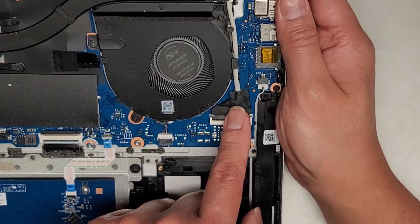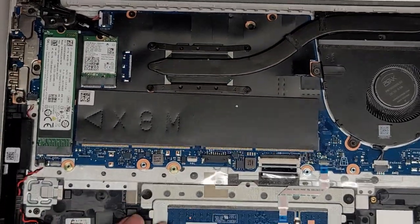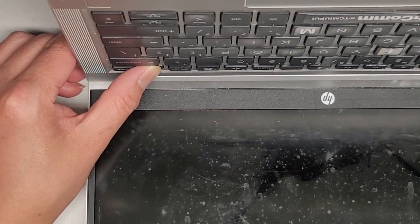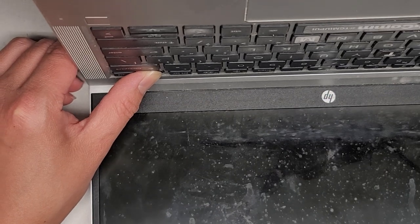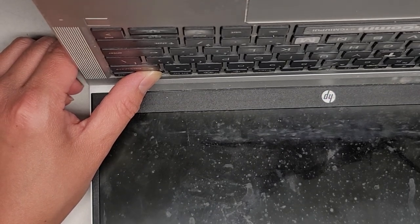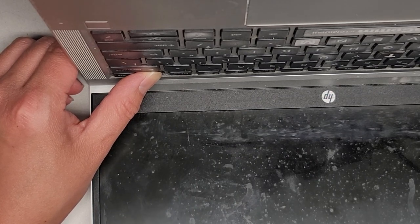There's a fan here with three screws. If you remove those three, you can probably pull the fan up, but sometimes they tuck a piece underneath the heat sink, so you might have to take that out first. Here's the LCD LVDS connector — if you're going to mess with this, it's very important after disconnecting the battery to press and hold the power button for at least 15 seconds. If you don't, this could fry the motherboard backlight circuit and you'd have to use it with an external screen forever.